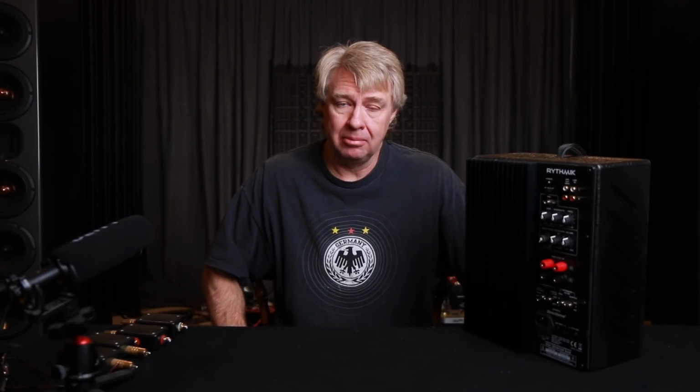And then with the open baffle application, wow, that takes things to another level. This is the only servo-controlled system out there for open baffles. So the open baffle tends to not load the room like a typical woofer will. You're moving air quickly from one side of the room to the other in more of a velocity of the output rather than pressurization. So you don't get a boominess in the room that you would normally get with a lot of other woofers. You're just getting a quick movement of that output, and then it dissipates real quickly. So it's a whole different ball game. Even an open baffle, those things will play flat to 20 hertz and they'll stop on a dime. So, really unique system.